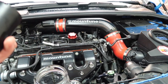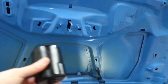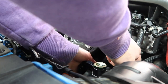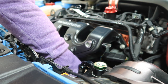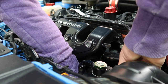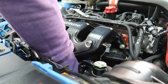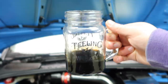Since we have the can out, I'll get rid of that tiny little bit we missed. You can see on the bottom right in the middle — you'd use an allen key to unscrew that little plug, and that's where you would put the petcock if you go down that route. We'll shimmy it back down in the same way it came out, position it on the bottom of the can, and tighten it up. Make sure everything is nice and tight if you're going down the method of removing the actual can.